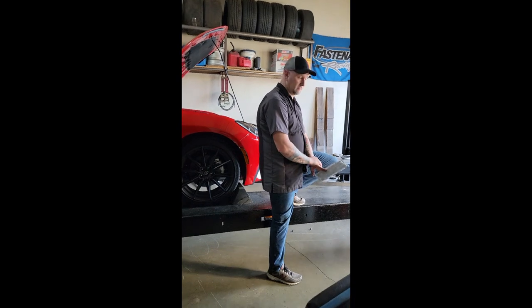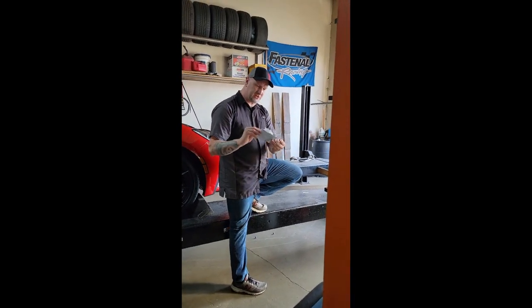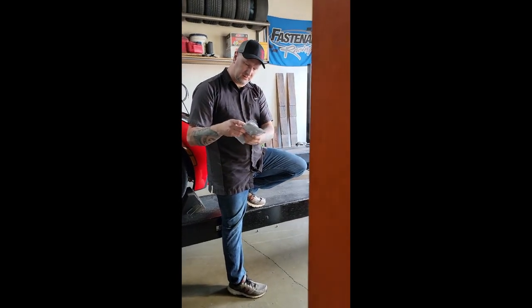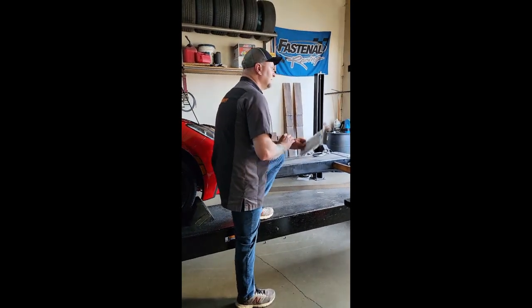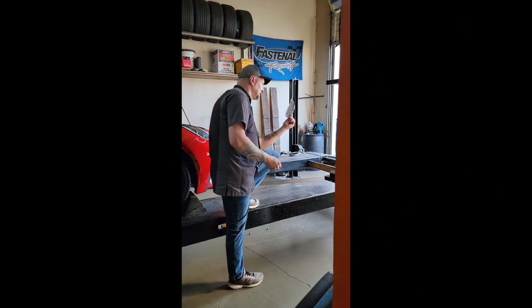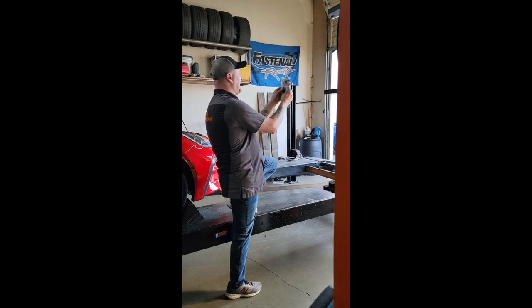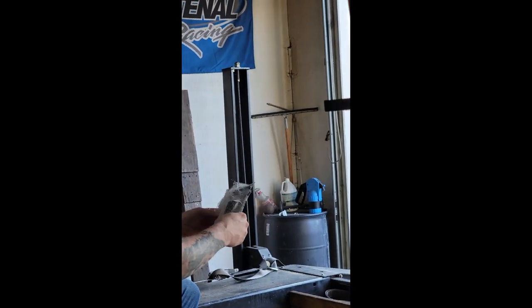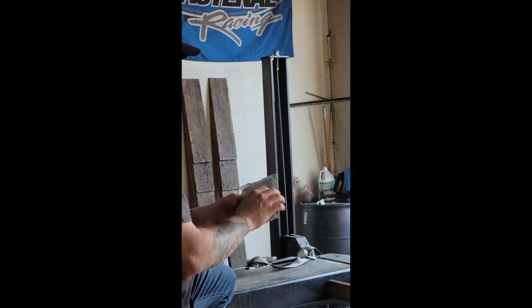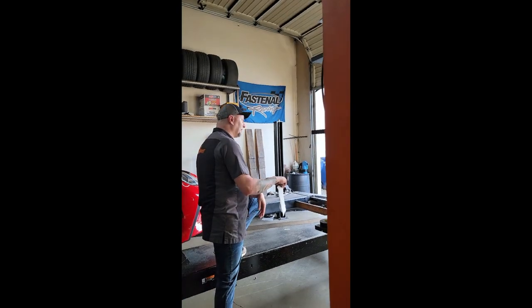That's what I'm doing. If you hold up the light, you can really see the opacity on that thing, how much it actually blocks off. But I don't know how much of this is dirt. You can't see any light through it when it's brand new. Because of how few miles that car has on it, I guarantee you most of what's in that was there from the factory. Interesting stuff inside the air box. This is the mat that we cut out, as you saw in the video. Just holding it up and looking at it in the light, I don't know, it looks like a fresh air filter with charcoal on it. Maybe the engineer wanted to make sure the air got smell-free air? I have no idea what the hell they thought.